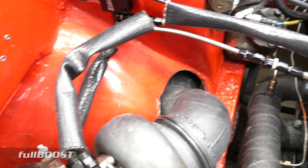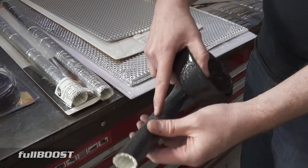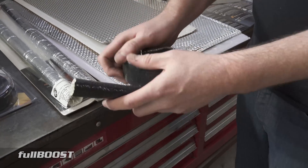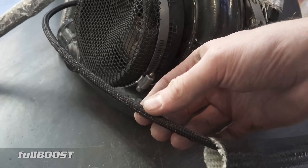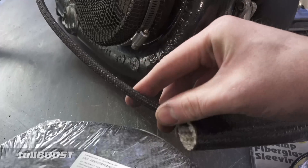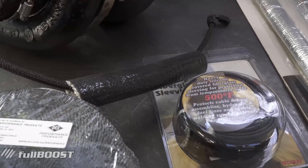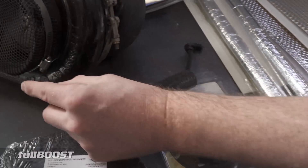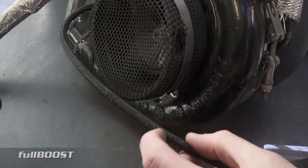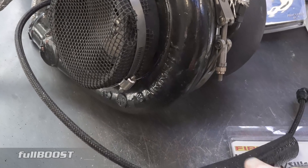It also offers good abrasive protection. Braided hoses — such as this Teflon-lined stainless hose — can rub away at paintwork, so if you've got an expensive show car and want to protect the paint, this helps. It also protects the hose liner itself: if the liner rubs through, it could eventually lead to hose failure. So this product provides both heat protection and abrasion resistance.